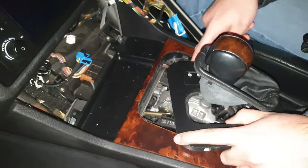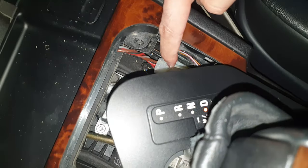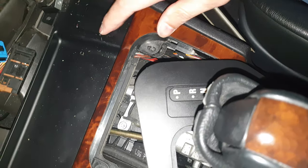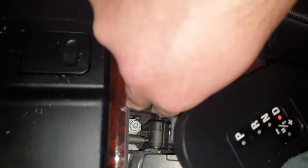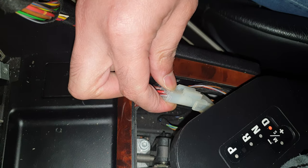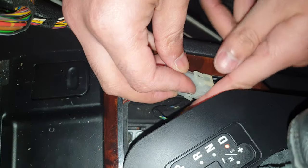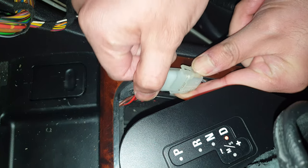So if you bring the camera here, there's the cigarette lighter, the connector's here to get it out. Just remove that first. So I don't know if you got a good angle from there. There it is. So I just unplug this. So I gotta either push on the back to pry that up, and then this should unhook. There's one on the bottom side as well. So I'll squeeze them, wriggle it off.